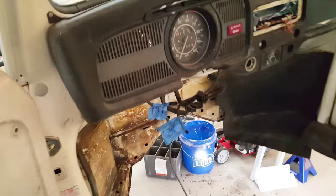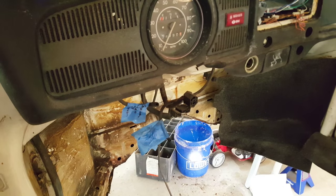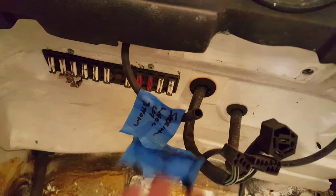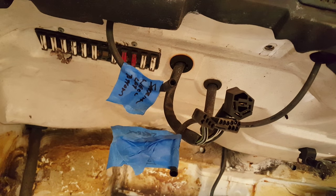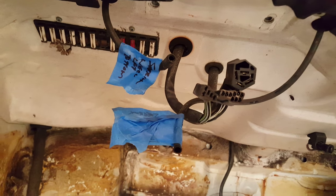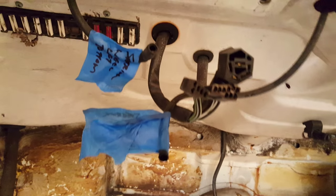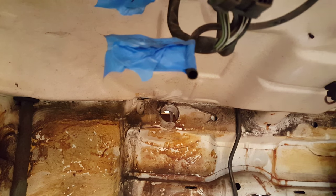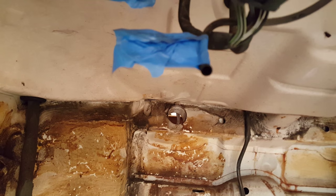On the front, you'll take the steering wheel off. All you have to do is take out two bolts here on the bottom, okay? This one and that one. And of course all the quick disconnects, and then there'll be the two wires in here. It looks like it was for the windshield wiper fluid. It goes to the side. You'll take those off. Once you do that, there's a bolt down to the chassis where it connects up.